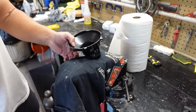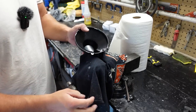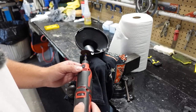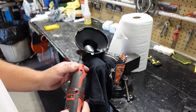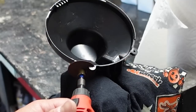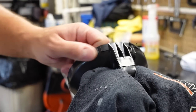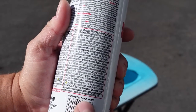I'm not going to take you guys through the mundane process again of prepping plastic for paint — we're just going to do the same thing we did with the tank cover. However, I do want to get rid of these little tabs because the OEM ones don't have that. These cutoff wheels on the Dremel kit are great — they're super thin and cut plastic so easily. Use a mildly slow speed and take your time. If you force it, that's when plastic melts and can sling all over the place. If you do this slow and try not to get it too hot, that's the best way to cut plastic. I'm coating these in a semi-gloss white from Rust-Oleum.